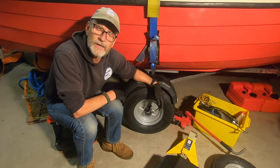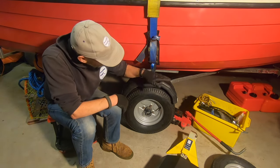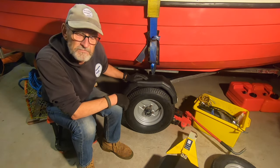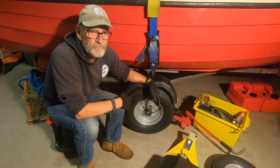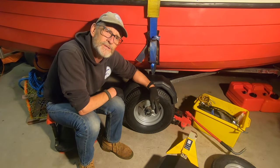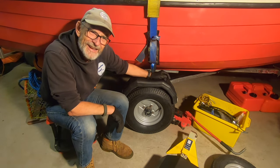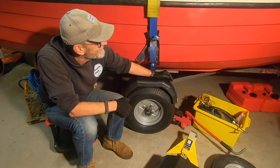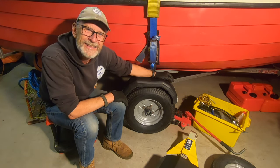I hope you found this helpful. It's a good upgrade for me — it suits me, though it may not suit everybody; some people may have 13-inch wheels etc. The only downside I can see is the cost of change, and maybe a couple of extra inches on the trailer means having to back the boat a little further into the water. But to be honest it comes off the trailer quite nicely on the rollers — I replaced all the rollers a couple of years ago. So next time you see the boat she'll be on the 10-inch wheels, and I'll feed back on what I think. I reckon it'll tow a lot better and be a lot smoother on the road. Hope you enjoyed it — see you in the next video.